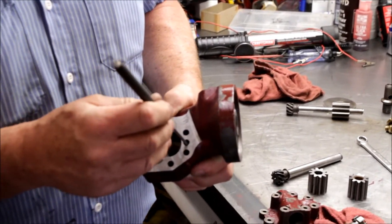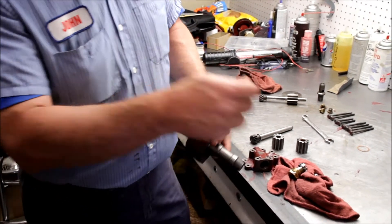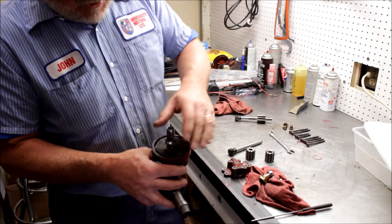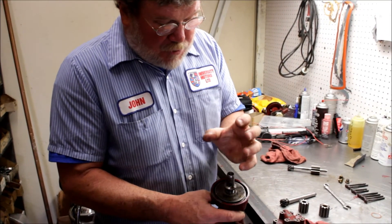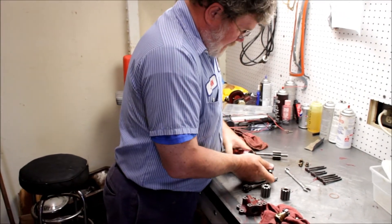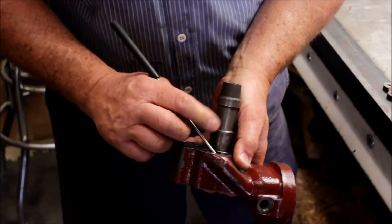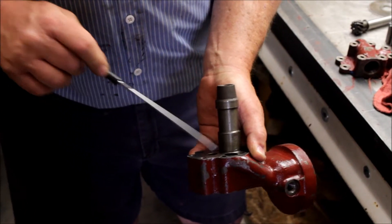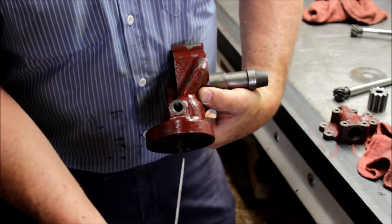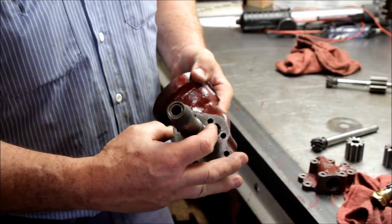All of our oil ends up running through this quarter-inch hole. There's a cross drilling that comes out underneath the filter plate here. Here's the filter plate and here's our housing that holds our filter, and the oil washes out around the outside, covers the outside of the oil filter, presses through to the inside, goes back through these holes on the inside, comes back down through here and through a cross drilling that comes across from the inside, up to here, over to here, and then down to here.